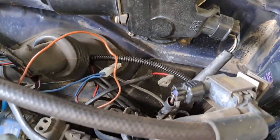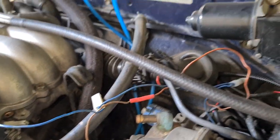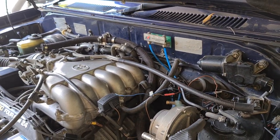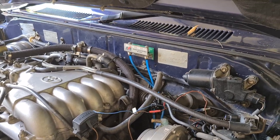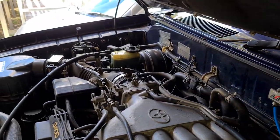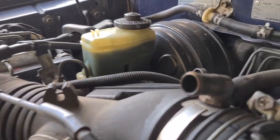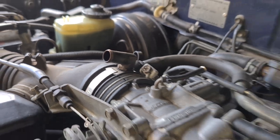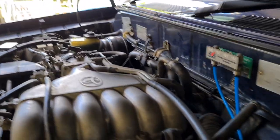What I'm concerned about is if I unplug all this cabling and the switch in the dash isn't on for the sub tank — after removing everything I'll need to start the car and find out whether it still runs. After getting rid of that hose, I've now got an open intake to the throttle body, so I'll need to bung that up somehow.